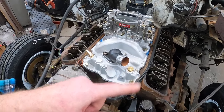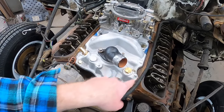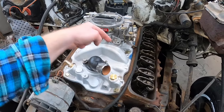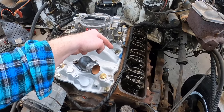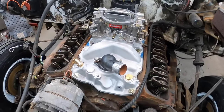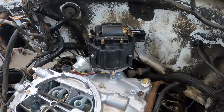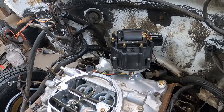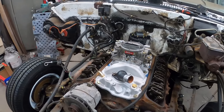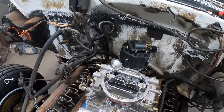Hopefully yours works better than these — maybe it's a bad casting, maybe it's a common thing. These are for the four center intake manifold bolts, so don't forget to use those. I would suggest getting the intake manifold bolt kit — I didn't, and that was a pain. I'm using a mixture of aftermarket bulk bolts and had to cut the center ones down a little bit because they were barely touching the push rod. So don't be cheap like me, just go ahead and get the intake manifold bolt set. In the back here, that's your run-of-the-mill off-the-shelf HEI distributor — you can order that for any HEI Chevrolet. I think that one originally came off a 77 C10 — it's been sitting on the shelf and we're going to reuse it.